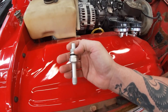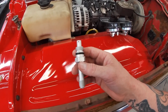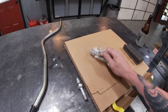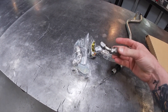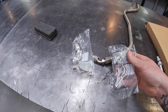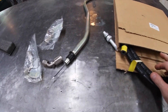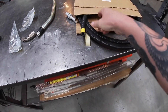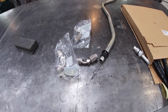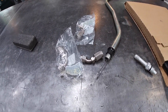You'll know right away if the orifice isn't big enough — it won't have pressure at idle, you'll hear it moaning like crazy, and it won't have good assist. I suggest calling Turn One every single time you order one of these fittings. We're going to get this in and build the power steering pressure hose. We use Earl's power steering fittings — they are a reusable end, and you have to make sure you use those steel power steering fittings with their line. This is all stuff you can order through us. Today I'm going to put this fitting in the pump and build the power steering pressure hose.